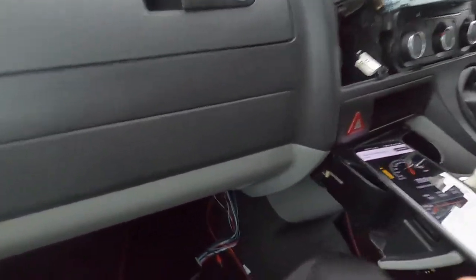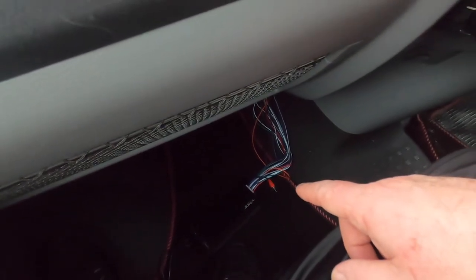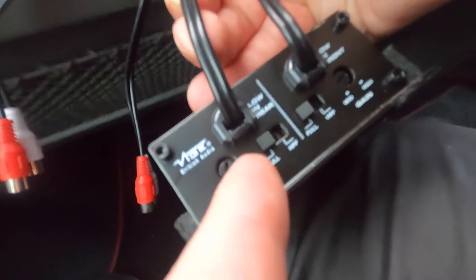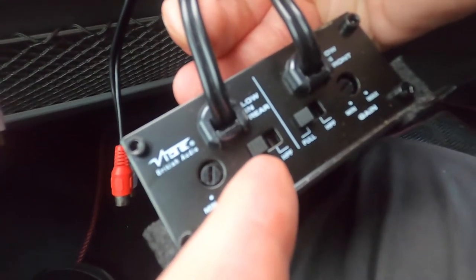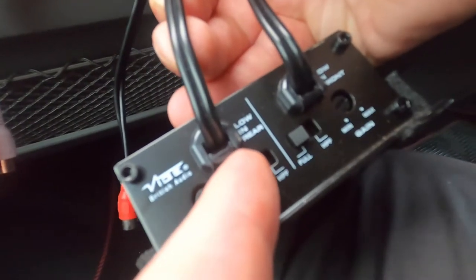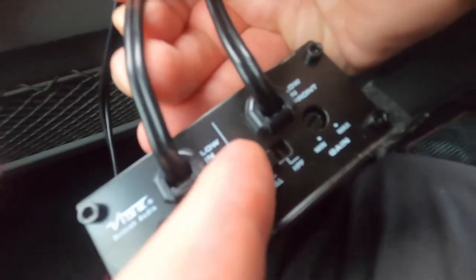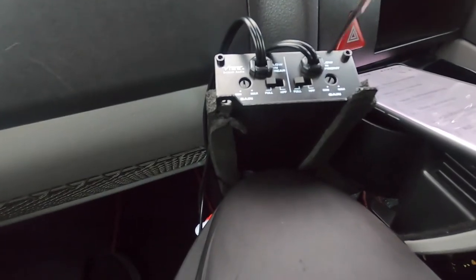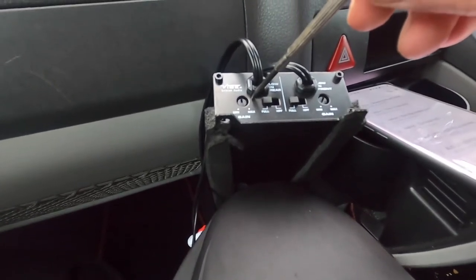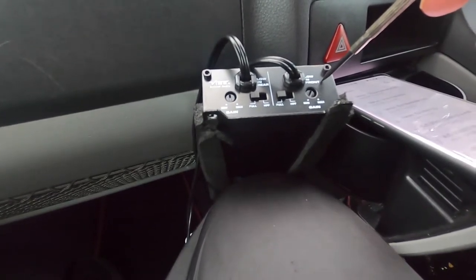So next thing I'm going to put the amplifier in — wire the amplifier in, that's down by my feet at the moment — and I'll try the same piece of music. Without the subwoofer installed you have it to the full range. If you move it to the side it takes some of the low frequencies away from the door speakers. You can adjust the gain on here — this is for the front, that's for the rear. There's no rear speakers actually installed, so it's just the front one we're talking about here.